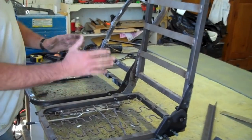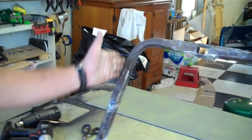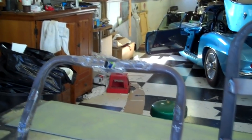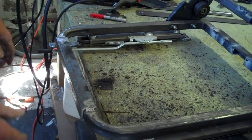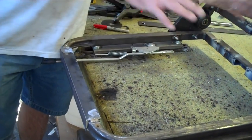This is what it looks like when it comes out of the box. We are transforming it to where it looks like a factory '61 seat. We had to cut it around for the convertible top, lean it back — sort of lay back just like the factory one does — lengthen it about three and a half inches, and cut it all apart to get everything lined up where it'll actually fit just like a factory seat.